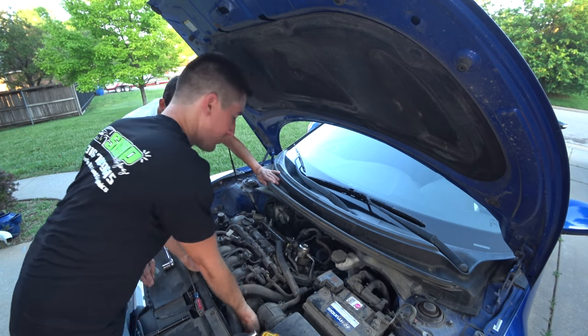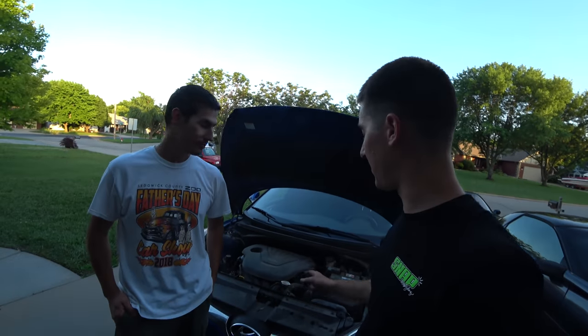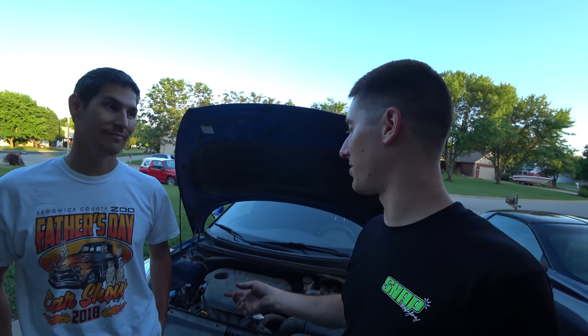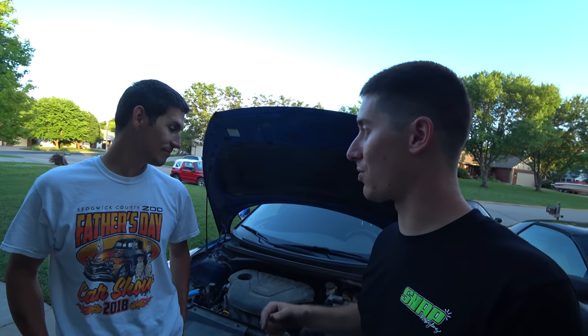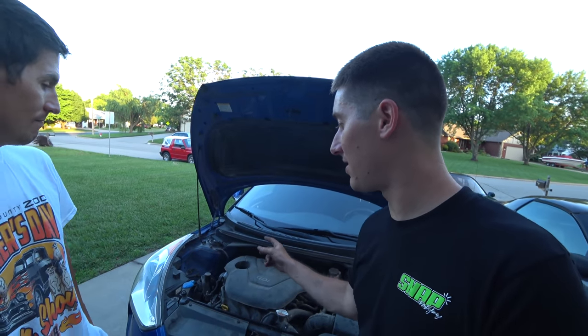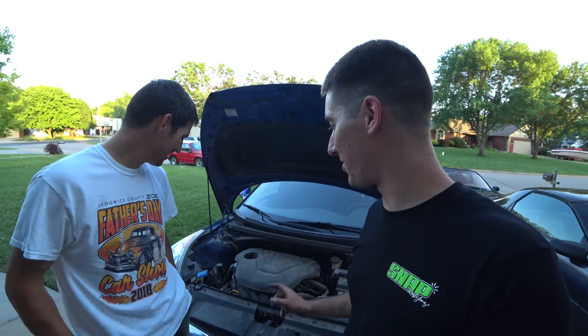On top of the transmission in one of the castings, I think. Well, we have the slightly unfortunate, but also it's really not that big of a deal. The difference between $64 and tearing the whole car apart and $500 and tearing the whole car apart is about the same. It's still a whole day of our labor, honestly. And once we get in there, of course, we'd end up doing everything else that went along with it, probably do the plastic guides. And the other problem was, if it was the variable valve timing cam sprockets, they're $250 each. Either way, maybe next week we'll get this back on the road,